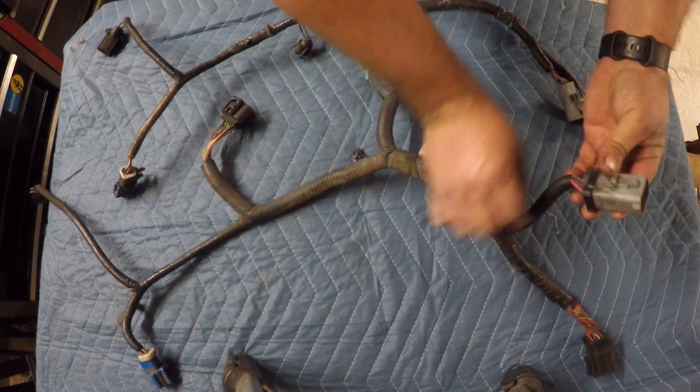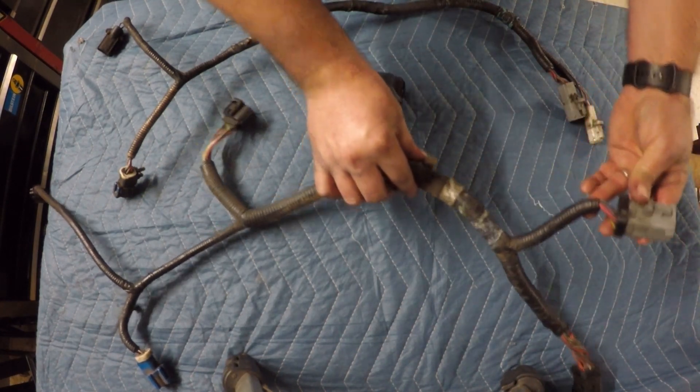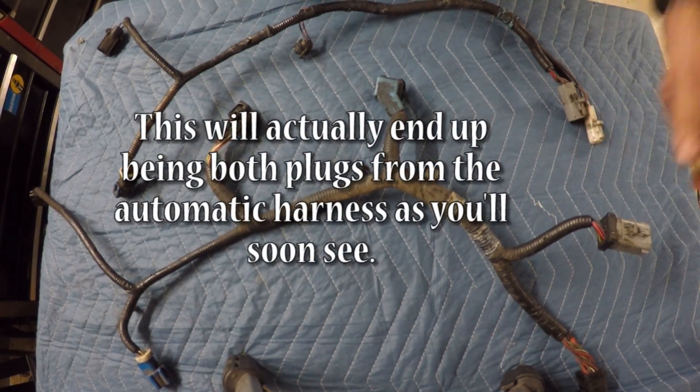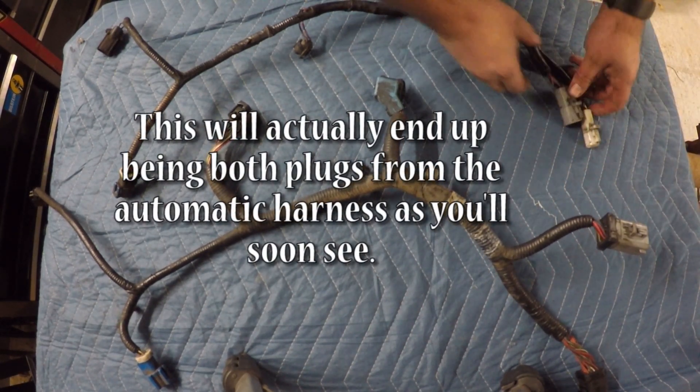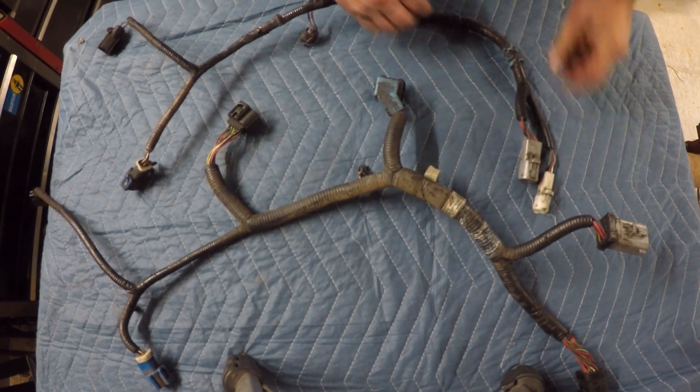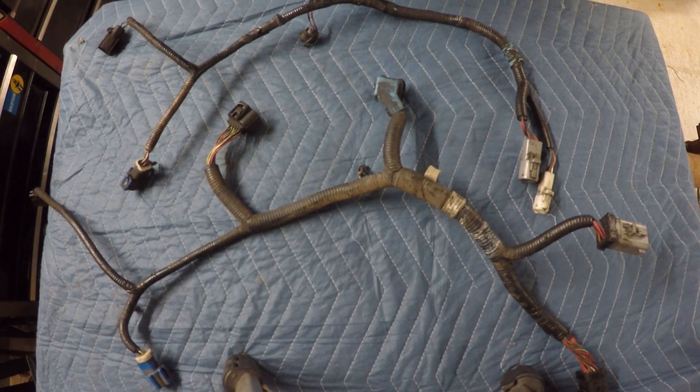So I'm going to steal this plug and a large section of wire from this harness — this is the plug that gets used to connect to my engine. The other end will have the matching plugs that hook up to the manual transmission harness, cut from the donor vehicle's harness. It doesn't need to be very long, it just needs to adapt the two harnesses together. From what I can tell so far, all the wire colors match up, so this should be pretty straightforward. Regardless, I recommend getting a Haynes or Chilton's manual with decent schematics to verify your wire colors.